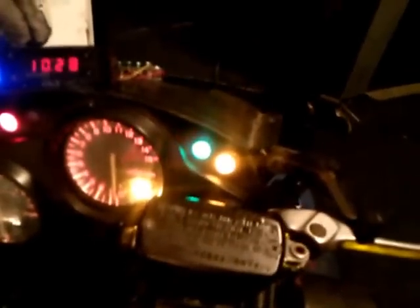But the problem with this is when the light is on like that when you're just driving — especially in the back, it's flashing. What I did here is I connected this wire and that wire together. But the problem is that it puts the orange light on and the tail light stays on. Yes, it'll flash, but you don't want the light to stay on like that when you're just driving, especially in the back. And if you're on both sides, you have no tail light. So that's no good.